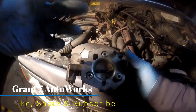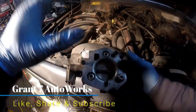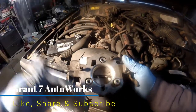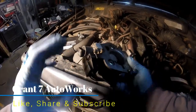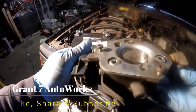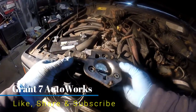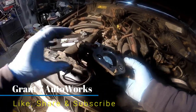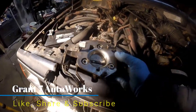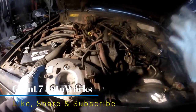These get all gummed up and terrible. You can clean those with brake cleaner, things like that. But sometimes after you do it, you'll still get the high idle - it's not consistent. Sometimes it'll stop for a couple of days, then it'll come back. Some other guys will tell you to check this - this is your throttle position sensor. It's connected to the lever. To adjust this properly, you would need a multimeter - plug it in, turn the switch on and get your readings. I did all of that and it worked fine for a couple of days and I was still having problems.